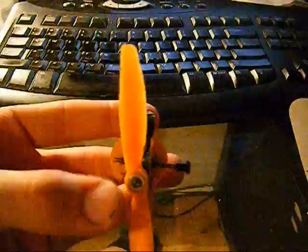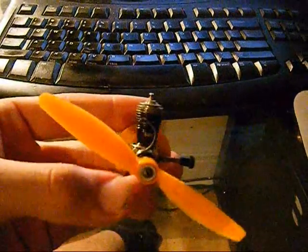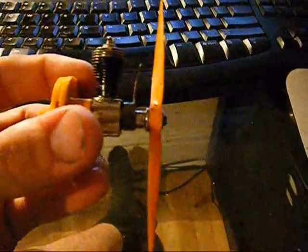The only other question was which way does this engine spin. In this case, it spins counterclockwise looking straight at it. You see there's a little spring there — it's still working. I had to re-bend it to make this one work, but that's the way it spins and starts and runs fine. The pitch of the prop is also right — it's a puller, not a pusher.